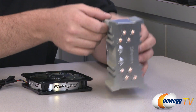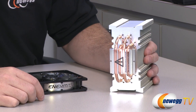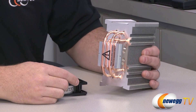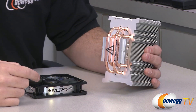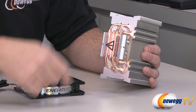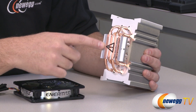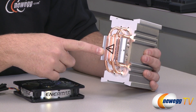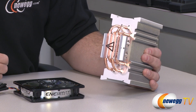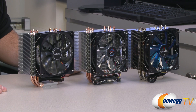Down at the bottom you'll notice there is protective plastic pre-installed — you want to peel that off before you apply your thermal paste. You'll also note that the copper heat pipes have direct contact with the CPU once installed, and generally speaking direct contact copper pipe heatsinks provide much better cooling than the alternative of copper pipes going to a copper base plate.